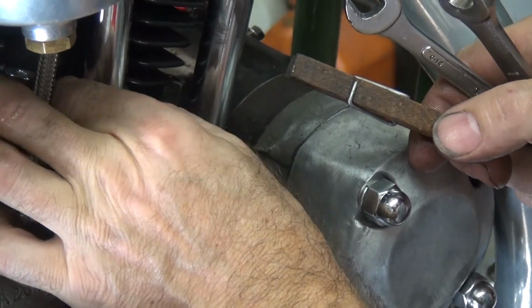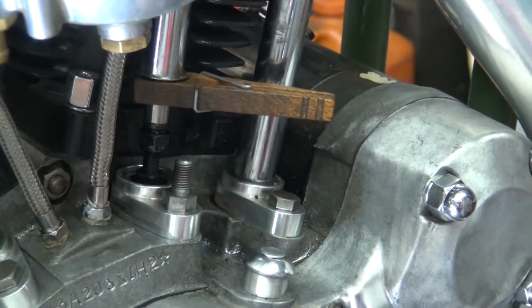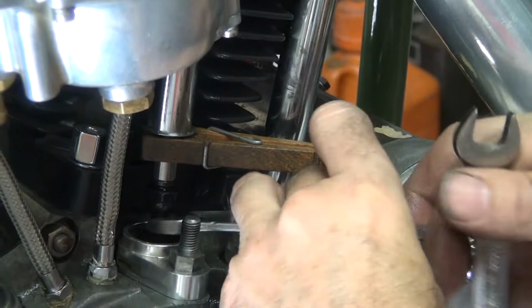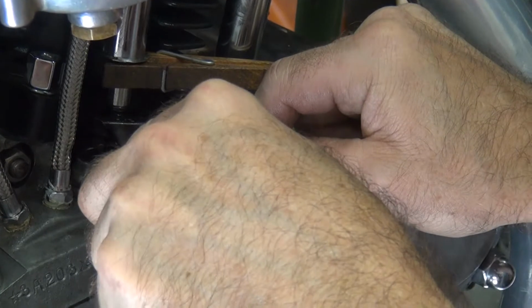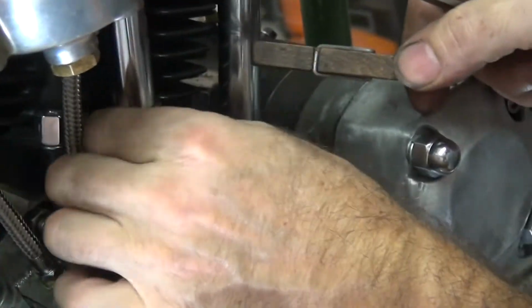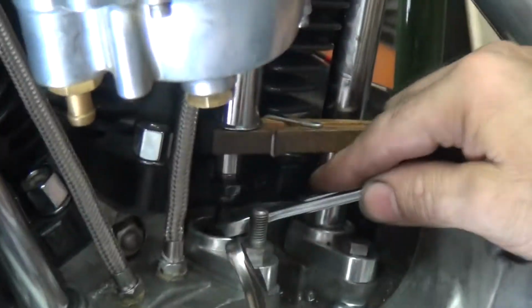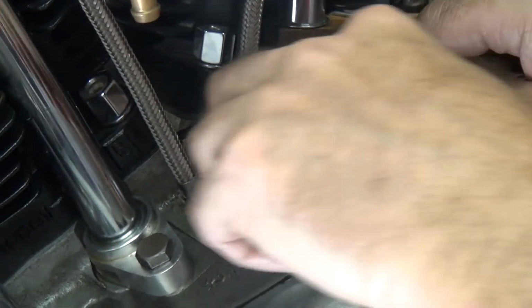This one's more even. This one's real close, got just a couple little tight spots. So I want to loosen, tighten the valve, tighten, get another bite on it, whoop, and tighten a little bit more. A little bit more, loosen the valve up. Because I got a little more tightness on this bottom here. Because the more I tighten this, the looser the valve will get, because I'm screwing the screw down as I'm tightening it. So you're kind of fighting against each other.